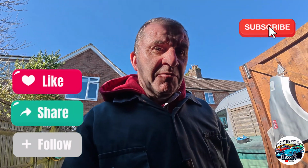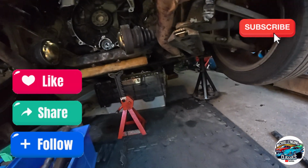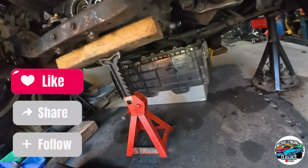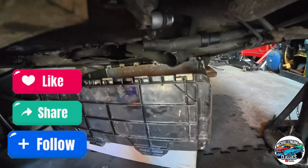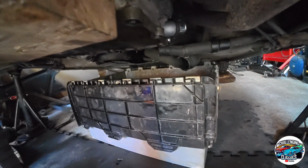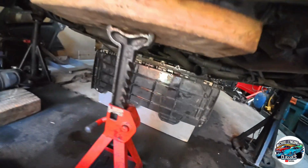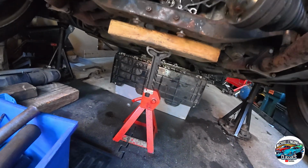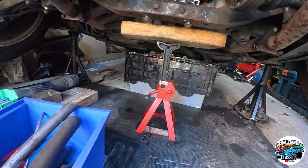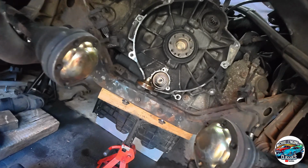We've got to the stage now where we have the sump back on underneath, and we've drained all the coolant from the system as well. You can see under there, there's the hoses. You would have seen this before in previous videos, probably, if you've been watching the series. All coolant's in there. Well, it's not even coolant, it's just water. The engine's suspended by its forward engine mounts and this jack. Gearbox is out, obviously. RMS bearing is sitting in there.